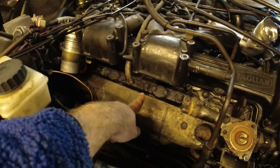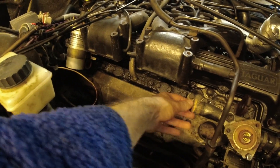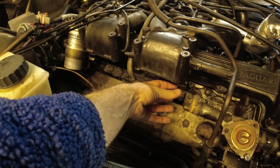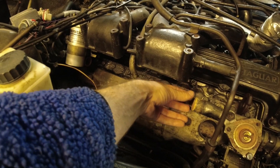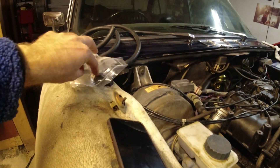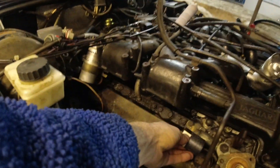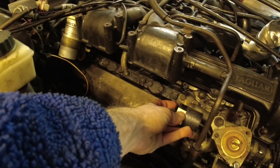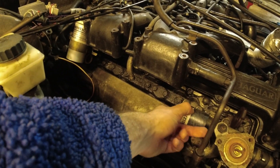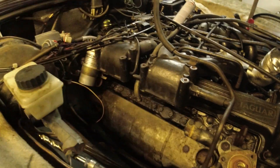This is what it looks like with all that removed - you can see the pipes here. What I do is slide the new hoses on here pretty far. Here is what they look like. I try to slide them on almost that far, then make sure I can slide them back. And that is sort of the trick to getting this all back together.